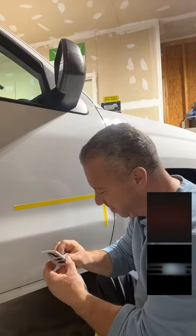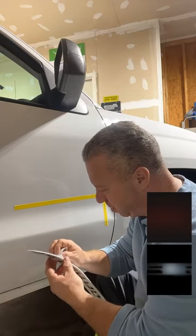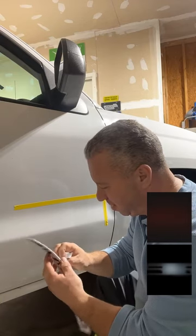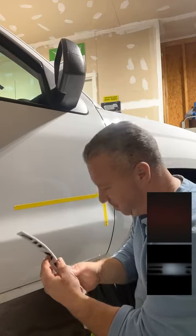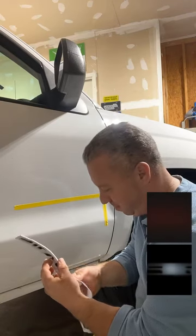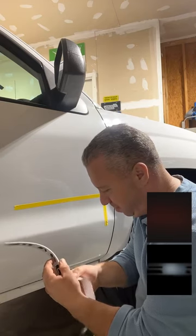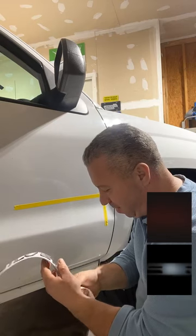So when I do headlights, I do all of my repairs. I get them down ready to coat. I hit them with the 3D wipe with the blue shop towel on a roll. I then take IPA 50/50 and hit them again. And then I do my coatings, and make sure that you're wearing black gloves, because that ceramic coating will soak into your skin and it will burn.